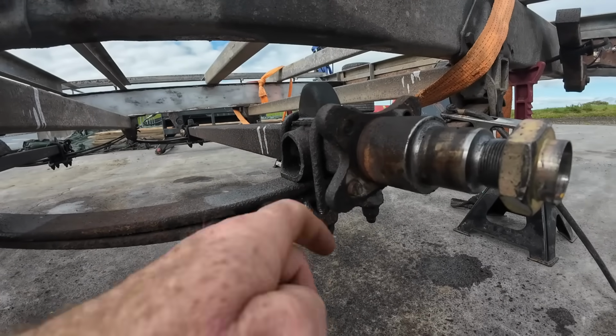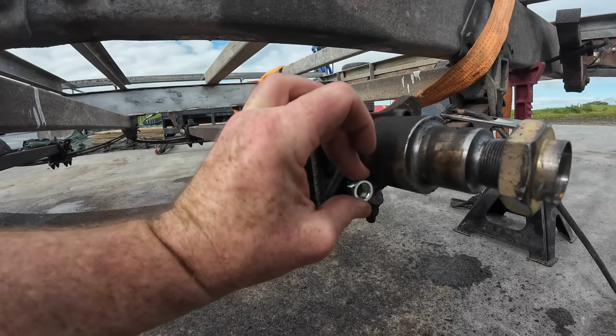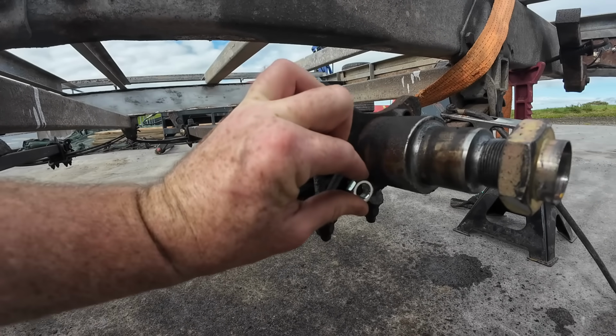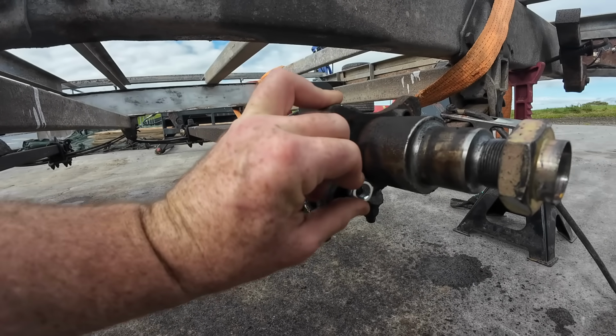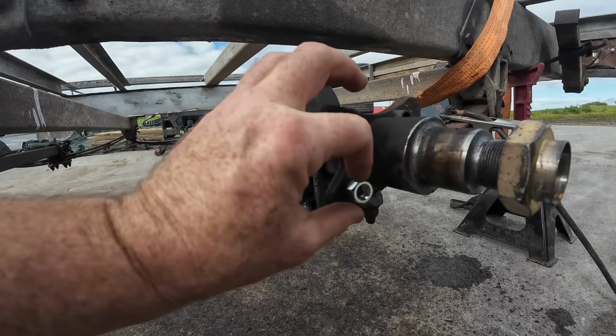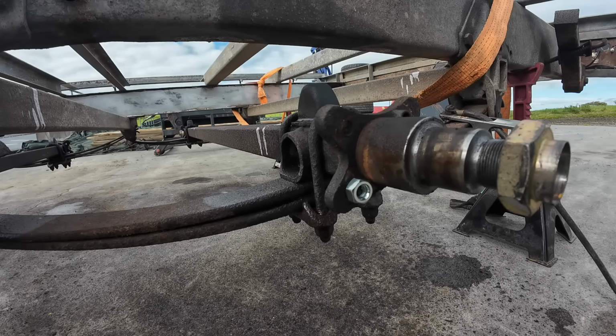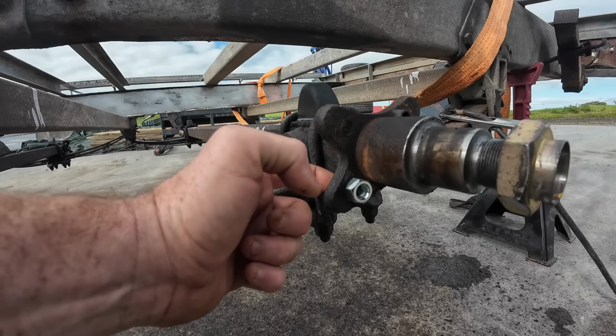Alright, so we're going to take out these studs. So take these studs out, we're going to put a nut over them like that. It's roughly around the same size. Threads on a little bit as well, maybe even better. And we'll just come along now and we're going to fill in there with weld, and then we're going to hopefully just unscrew it. The weld will also help to heat it up from behind.